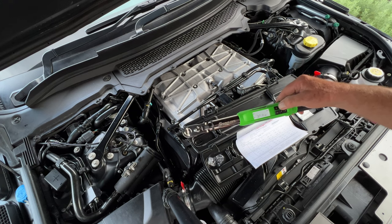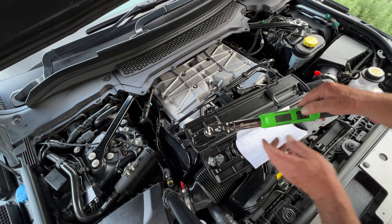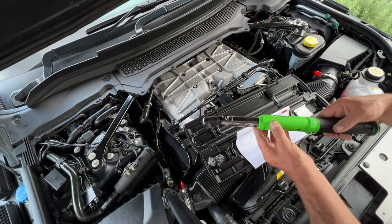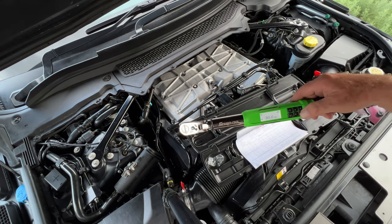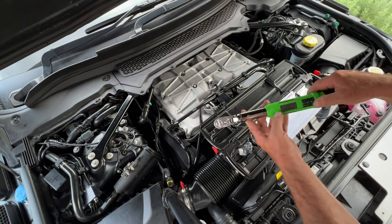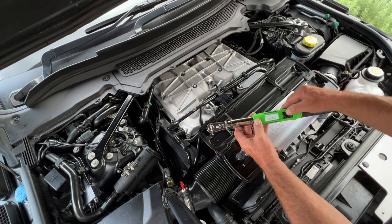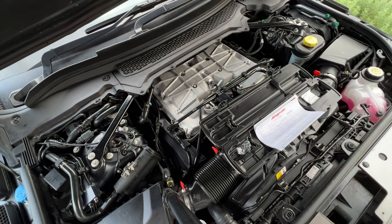Most things on cars are 20. I mean, the oil filter is 25, sump plugs 25. I mean, look at that for a bit of kit. I'll give you a little demo on the strut brace nuts. So at the moment it's set on 31. I'm going to do the 40 because it won't be any more than 40 Newton metres.